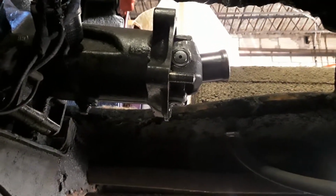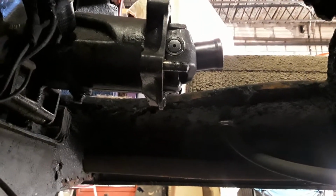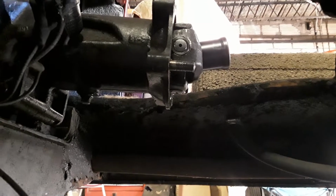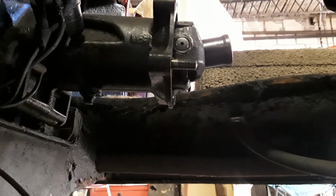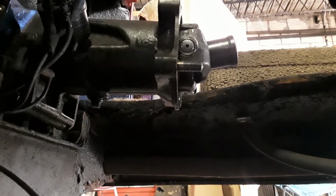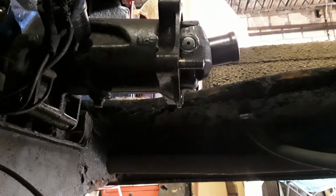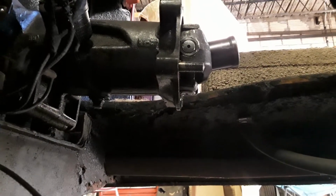Speaking of which, putting the rear end back in, something else I'll point out on camera because I'm looking right at it: the Ford universal joints. You've got to be very careful when you buy these that you make sure it makes full contact all the way in and tight against the bearing in the rear of the transmission. If it's sloppy, it will damage the bearing, it can damage the shaft, and effectively ruin a transmission.